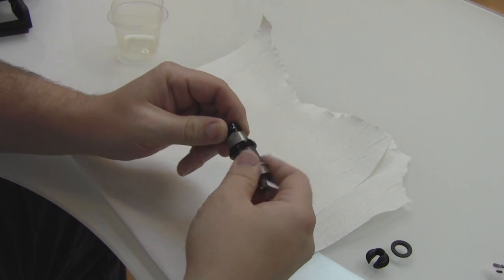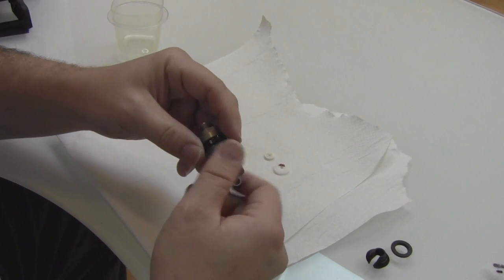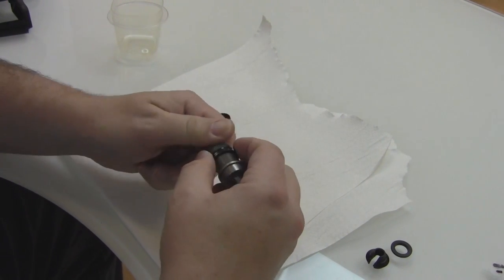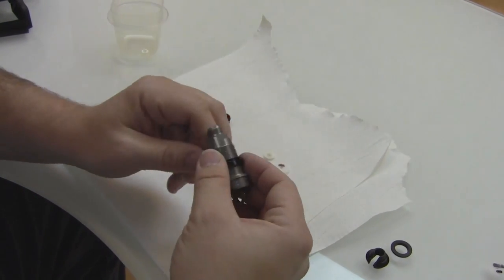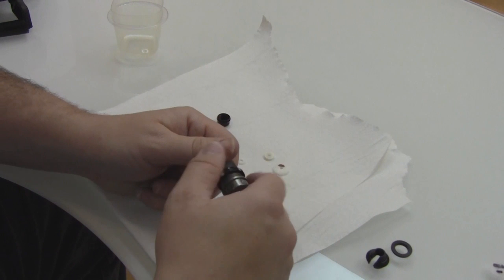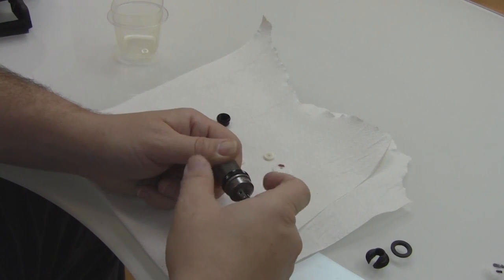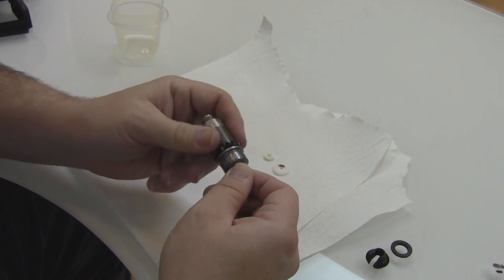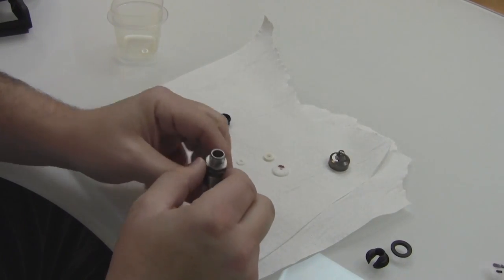First and foremost, just unscrewing the lower shock cap eyelet. What I do is I actually put the preload collar all the way to the top. That makes it easier for when I'm putting the shocks into a shock stand, at least with the fronts. With the rears, I'll leave them down quite a bit. That way, again, it will sit a little bit easier in my shock stand. Pull the shock top cap off, and we're ready to get started.